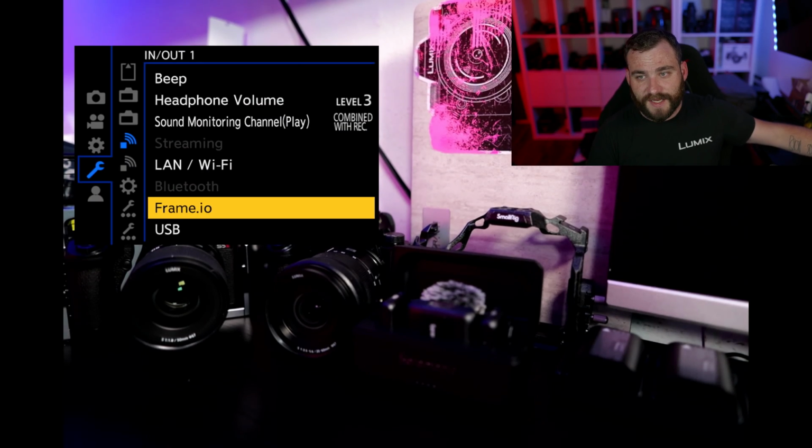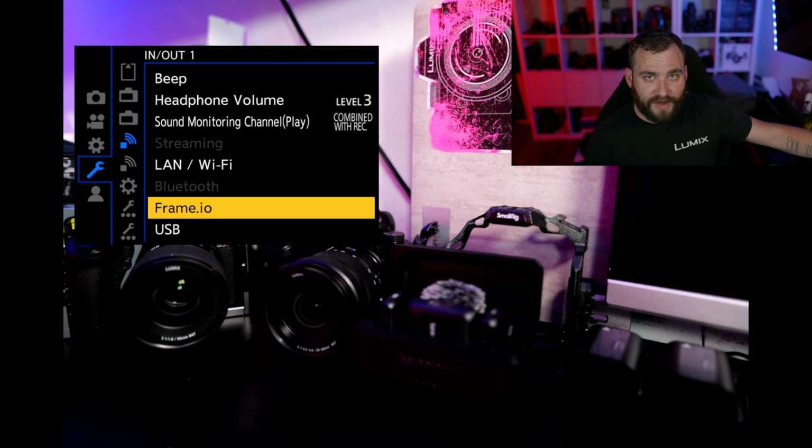If you've got a mobile device with tethering functionality, just tether off your mobile device. You can also tether off hotspots, things like that. If it's an open network that doesn't require a web page to log into, you can connect the camera to it, and you're good to go. Once you make this connection the first time for the camera to cloud functionality, and I turn the camera off, it will auto reconnect when I power the camera back on to that network.